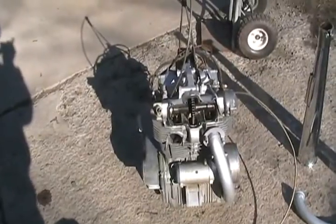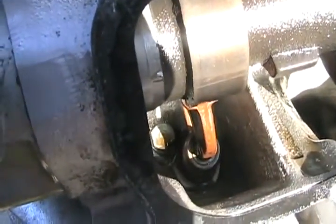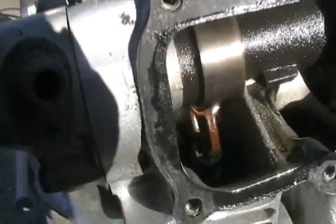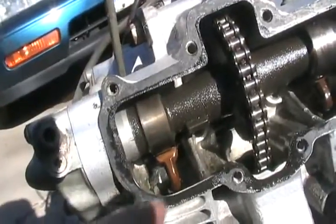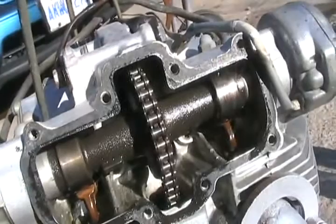They're both in great shape and I decided to check valve lash adjustment. We got the motor out — you can't do it when the motor's in. I thought I might want to show you what valves look like with no springs on them. The rockers on top push them down when the cam goes around and hits that pad, and if you look far back down to the left you'll see another arm that looks like a rocker arm — that's the little finger that lifts the valves up and keeps them closed. This has a shaft back in there, a torsion bar — it twists the shaft like it does on some cars with torsion bars, and that's what gives it the springiness to pull the valve back up and keep it tight. Really unique design.